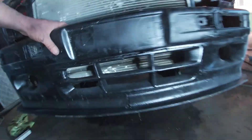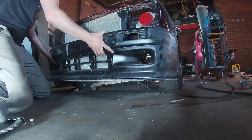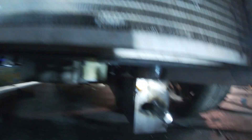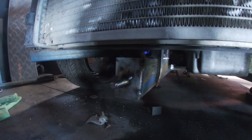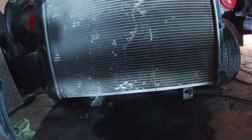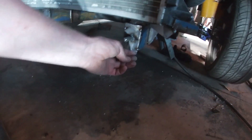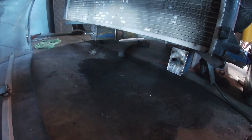Alright she's mounted - at the very start of it anyway. Look at that - got plenty of clearance on the splitter there. That's just tacked on there, I've got that one there and that one there. I've got these bits here and I need to just weld a little bit off here to brace it to stop it rocking. Then just drill these and file and taper them a little bit just so it slides on there easily. Yeah that slides on there - it's looking good, it's on at the right height. The chassis rails just sit on there. It's just been touching a little bit so I might have to grind just there, but once I fully weld that it's looking good.